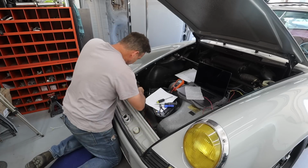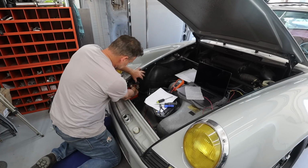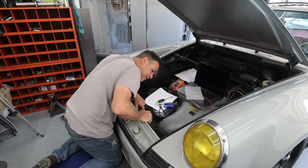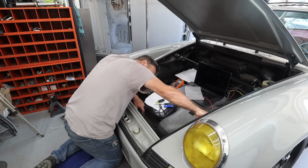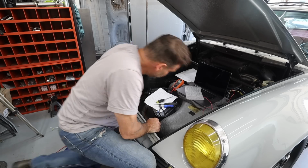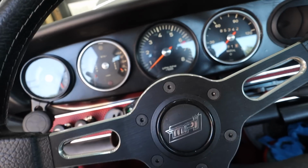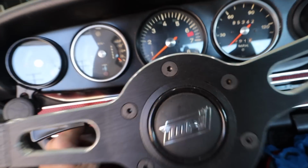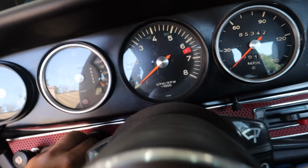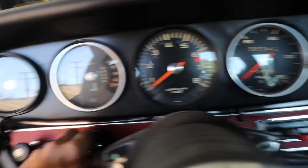All right, battery ground going on. Okay, nothing weird yet. Good, it's a good sign. Battery ground is on. I have no warning lights. It's good news. Okay, here we go. Now, as far as I know, this thing should function relatively normally, except the headlights shouldn't work. So this should be a red light. And I got literally nothing. Okay, back to the drawing board.